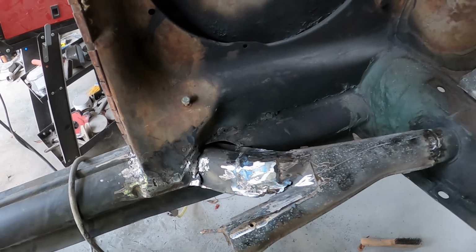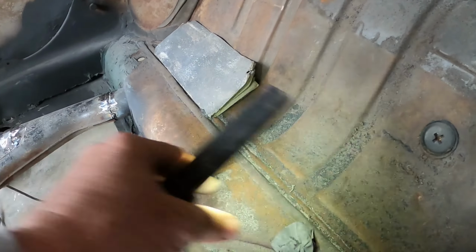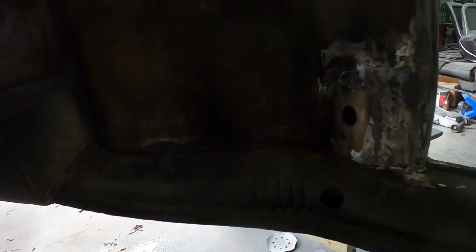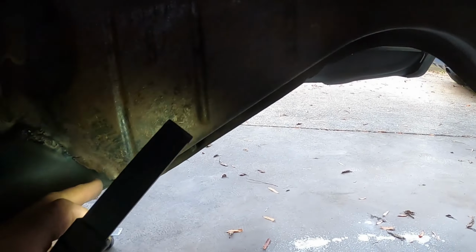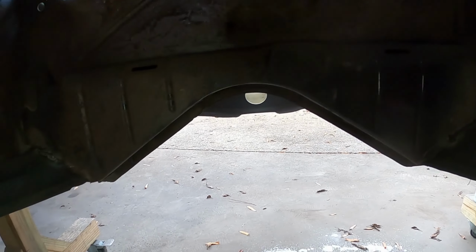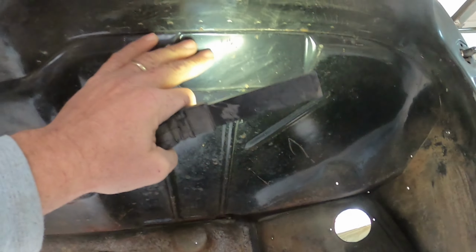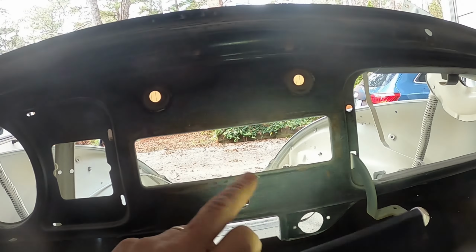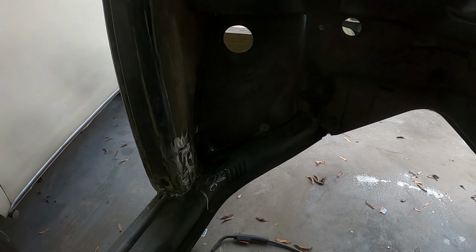And then what I'll do is do a final kind of sand down of those areas, and then I'll do the seam sealer in here and here, here, and then that'll be pretty much all the metal work, and then I can just start cleaning up. I need to sand, wire brush and sand this down. I started doing that here, you can see, but I'll need to do a pretty good job of that